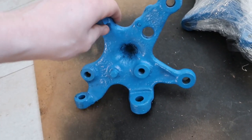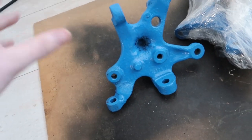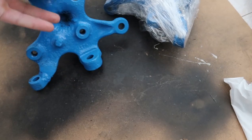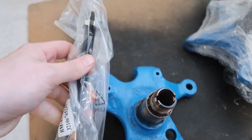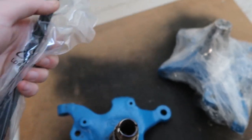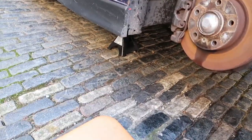The reason we're changing from the current setup - I'll show you in a sec. We've also got new nuts for the hubs just because I don't know what condition the old ones are in. We're also going to need the new E90 tie rods, as these are quite a bit longer than the standard E36 ones. Because the pickup point has moved and we've got extended arms, we need the longer tie rods. I don't know if we'll have to cut them down a little bit yet - we'll see.